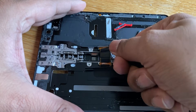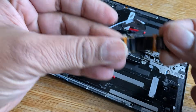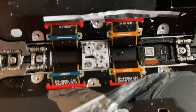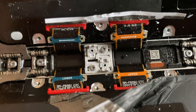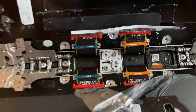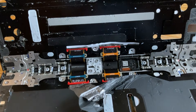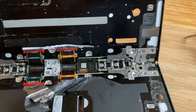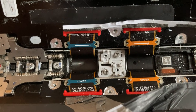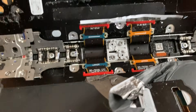Like that — that one's out as well. Alright, so you can see I've got the ribbon cables in. I managed to get the new ones seated. Those seals are there to stop liquid or anything getting through to the opposite side where the actual board and everything sit — just extra protections to minimize water damage if you do get water into this area of the phone. All of them are in and in position. I added a little glue on the right-hand side just to hold that ribbon in place.